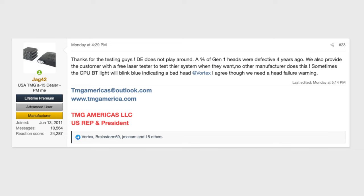We also found a pretty fatal flaw with the TMGs that we'd heard about before and saw firsthand here in testing: if a head dies, you don't get any notification in the cabin and it can take down your entire system without any warning, and none of the other heads will operate. TMG does ship their laser jammers with a little handheld tester — you press the button and it'll trigger your laser jammers to make sure they're functioning and you're getting an alert in the cabin. If you order TMGs, definitely test them out pretty regularly to ensure your system is functioning. On the forums, Jag 42 mentioned that sometimes the CPU's Bluetooth light will blink blue to let you know if you have a bad head, but there's no other audible or visual notification. Hopefully in the future TMG can add a proper notification to let you know that your system is down or a head has died — we see this with other systems and I'd love to see it added.